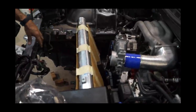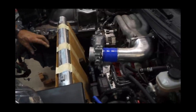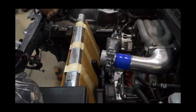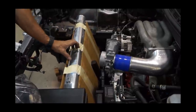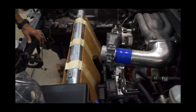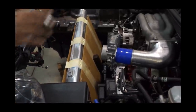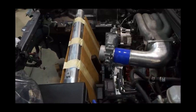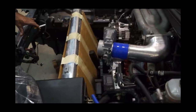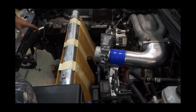The placement is going to be exactly like that. It'll be somewhat of a custom-made intercooler because we're going to have the inlet tank on the bottom, outlet tank on the top, and the tank is going to have a hump going straight into the fly-by-wire throttle body, making it a very clean installation with its own duct cord coming up to it. We're going to have a vented hood to get the heat out.